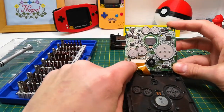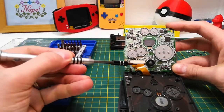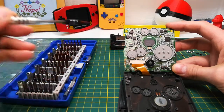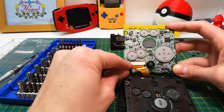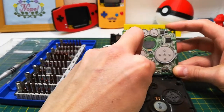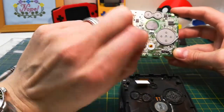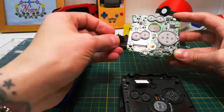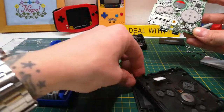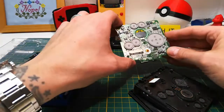If you haven't worked with a ribbon cable, you can't just yank it out. There are usually two tabs — in some electronics there's a little flip arm that goes across, but these are just two clips. You pull those out, and when you do, the ribbon just pops out super easily. And here are some of the silicone pads. I like to take off all the silicone pads.